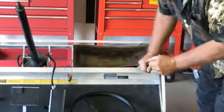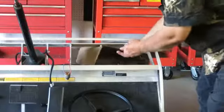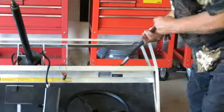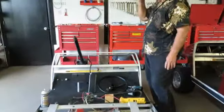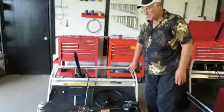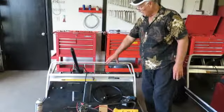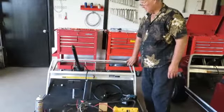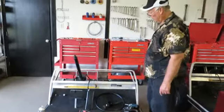There it comes. It's just a little tougher than the other. Then it would come out from the front. So now the glove compartments are totally removed. That procedure you did not have to do, but I like to do it especially if you're installing a radio in this panel, because if you're putting a radio in, it's easier to get to the wires and everything.